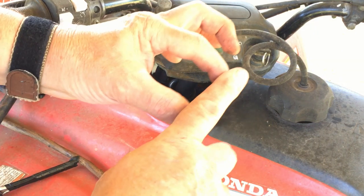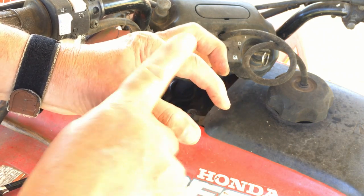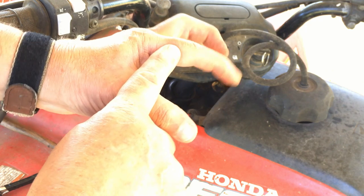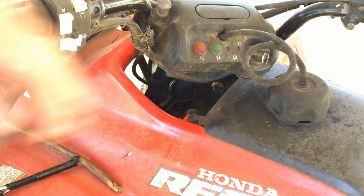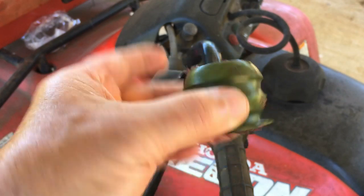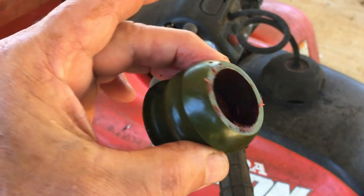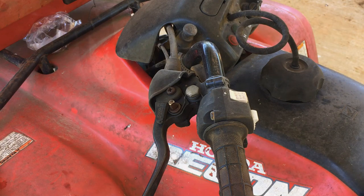The extension helped out on the other side more so than this side. I think I can undo one of the bolts and open it up enough without having to undo the other bolt completely — not dropping it down underneath, just open it up, put it in, close it up, install the bolt. I greased the inside of the bushing liberally with synthetic grease — doesn't have to be high-heat, just whatever you've got. It splits open, which makes it easier to put on.